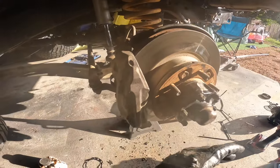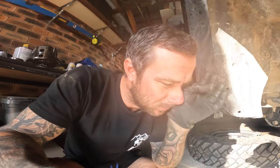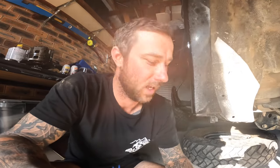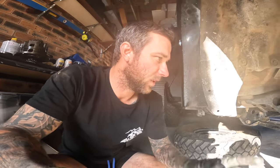I'm not going to bother filming pulling hubs and stuff apart — it's pretty much the same process as the back. Take your hub cover off; brake calipers are just two bolts in the rear, pull it off. If there's anything interesting I'll put the camera back on. So we've got one side of the front end back together — it's pretty much just a rebuild of the swivel hub. There's a good video on YouTube that goes for an hour — actually one of the best videos I've ever seen about rebuilding your front swivel hubs, that's where I got the aviation gasket sealant idea from.